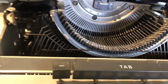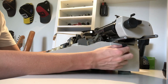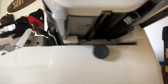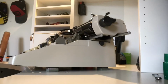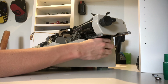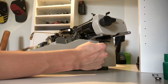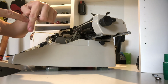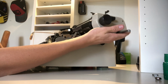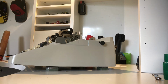I'll quickly show you how the carriage comes off, and so you can have a look at what's under there. So I've already been through this on my channel with these Universal Adlers. You just have 2 thumb screws there and there. And so to take the carriage off, you just loosen these. They'll go loose pretty quick, and then just give them a couple more little goes, because they basically screw in and hit like a little thing on each side that holds the carriage in place, like a little rod thing. And the carriage just lifts straight off like that. This is a very heavy carriage, so don't drop it.